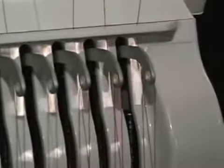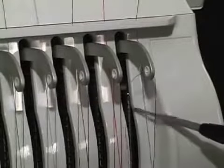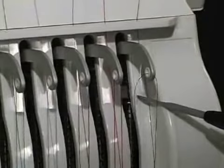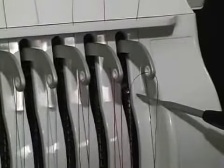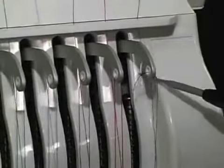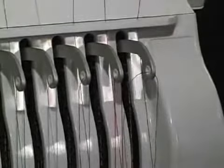The next place to oil is called the needle bar spring. As I'm moving it you can see the needle bar move up and down — the spring is on the outside of it. Your owner's manual recommends oiling it every three months; we recommend one drop every four million stitches. You're going to oil just the very top of the spring, not the needle bar itself. Gravity will take care of the rest.